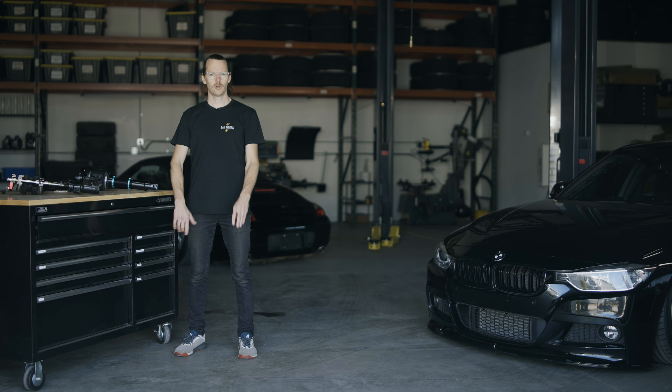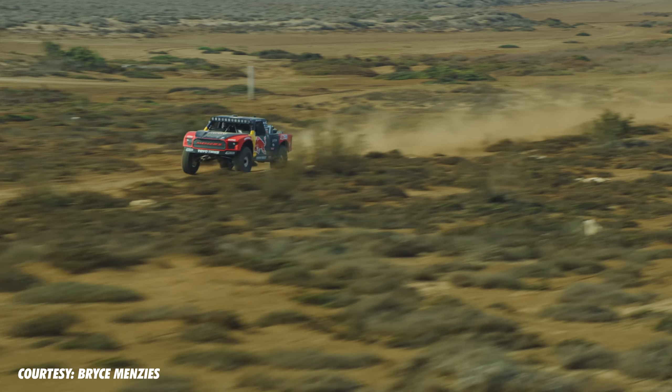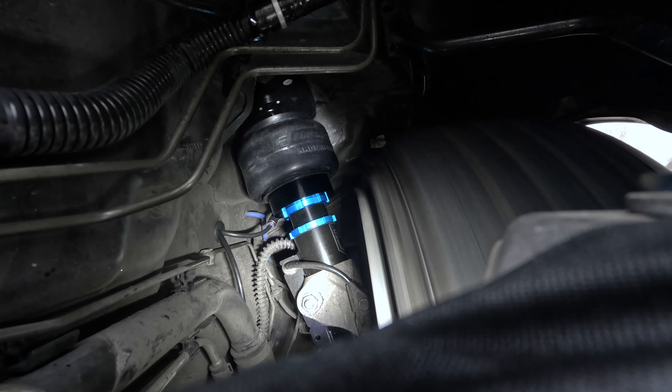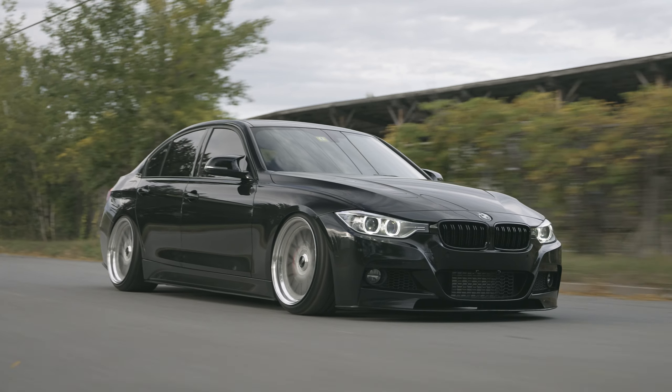I've saved the most difficult concept for last, which is topping out — it's the most complex to understand, so if you're an air ride beginner, please bear with me. Topping out is just what it sounds like: it's reaching a physical limitation of your suspension itself. It is very specific to air ride and really doesn't apply to coilovers. Unlike a coilover suspension, with air suspension while you drive around you can choose from a wide variety of different heights, and what determines that is the height of your bag and how much air is in your bag.